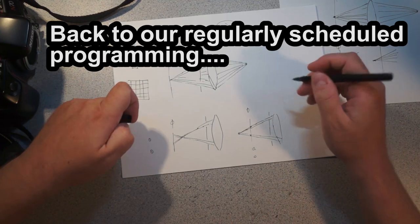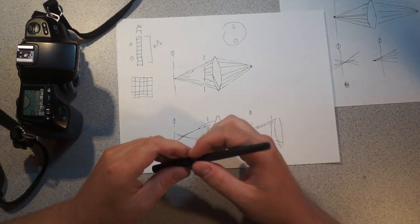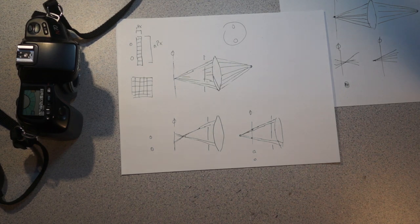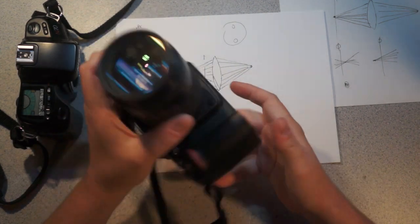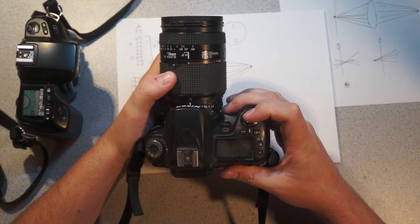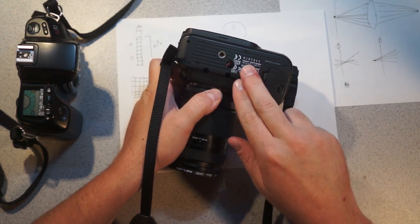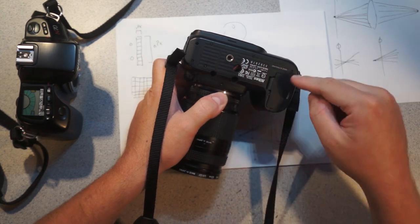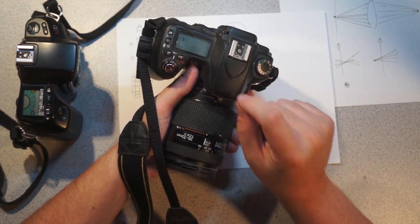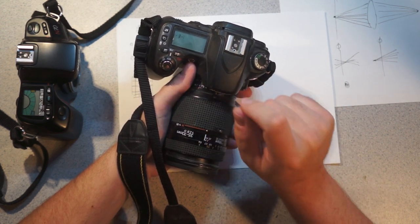But what we'll see here, and in fact it's not the first time I've taken apart an SLR, is that I'll probably insert and comment on some pictures I've taken previously when I did a conversion. So this is a Nikon D80 that I have converted to infrared. That conversion process involved completely tearing it apart. I took it apart to the point where I could get into the autofocus sensor and remove the IR filter from the autofocus sensor as well as from the main sensor, so that I also removed it from the metering, so that hopefully the whole system will work completely on infrared.